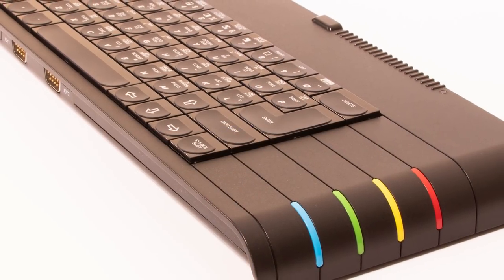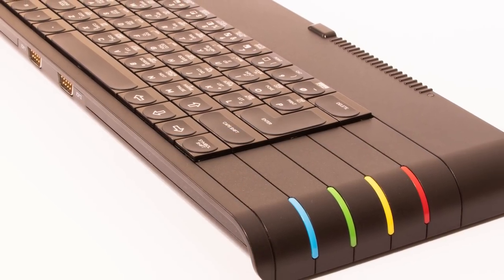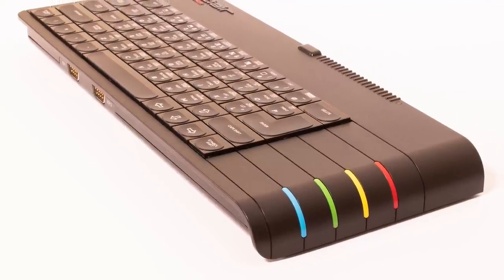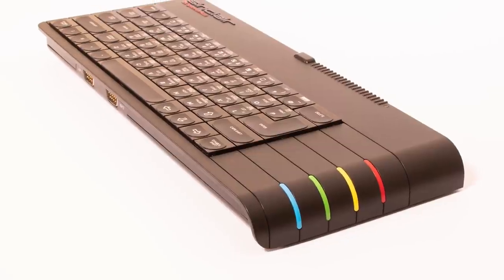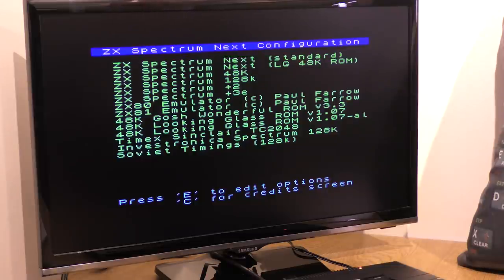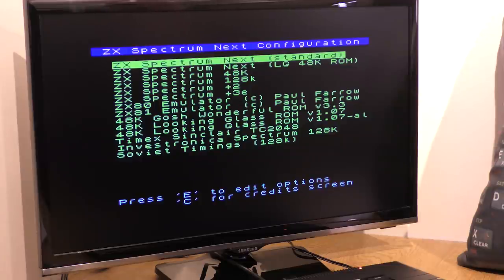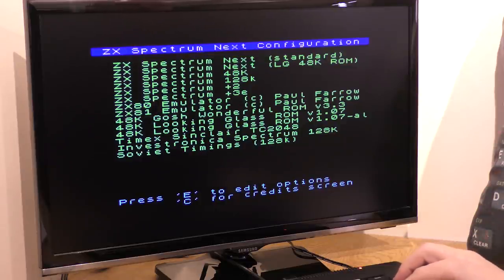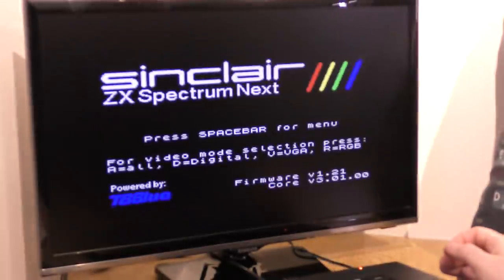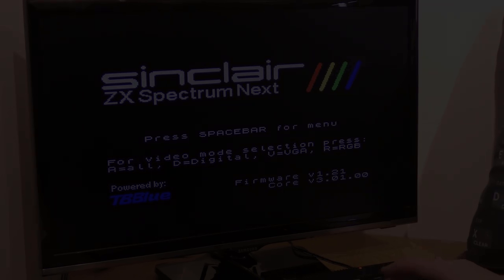A good experience so far. It's just a pity that those multicolour games are not working as they should — maybe there's a tweak, but I never found it. There is one final thing to try if you're having problems with games: hold down the space bar while booting, which gives you an option to set the Next to a specific configuration. Using this will set that as the default from now on, so each time you boot you will get it. The only way to get around this is to turn it off and on again and hold down space to select the option you want. Using some of these modes will disable the SD card, so be careful.